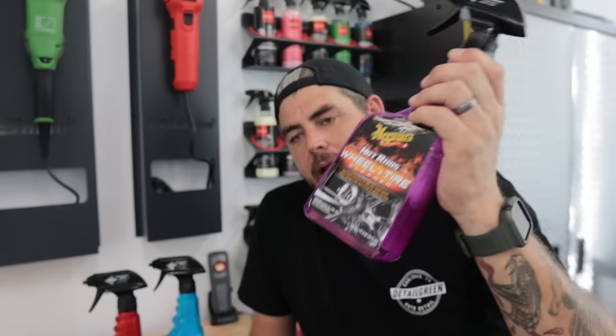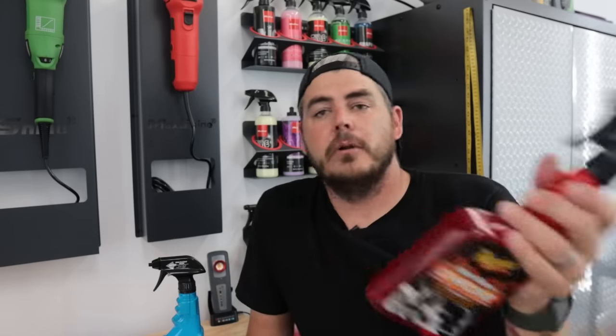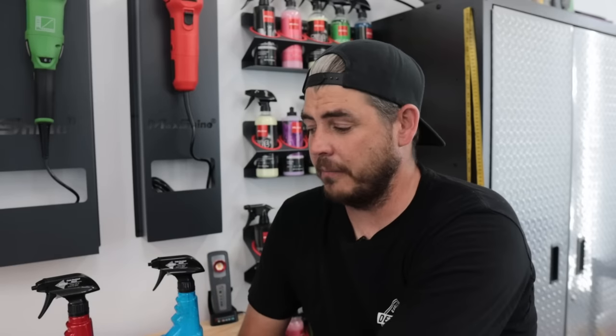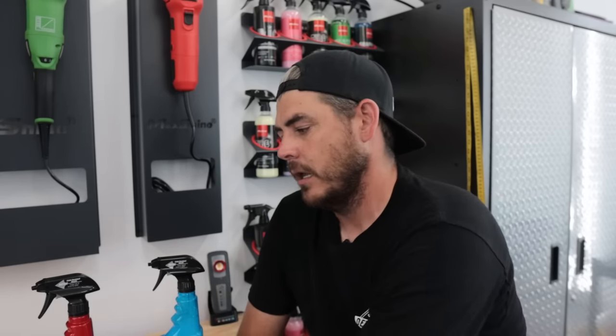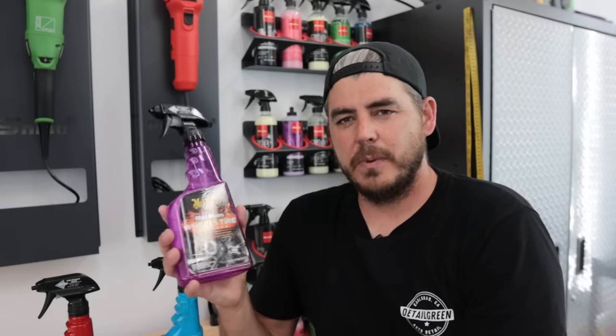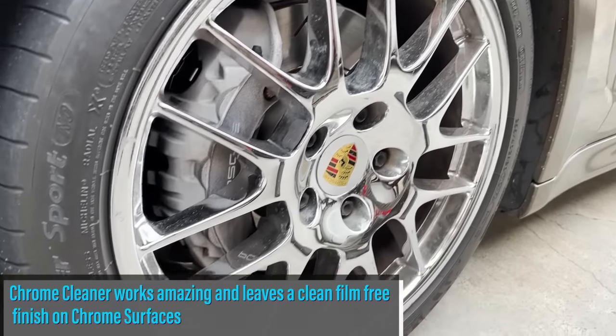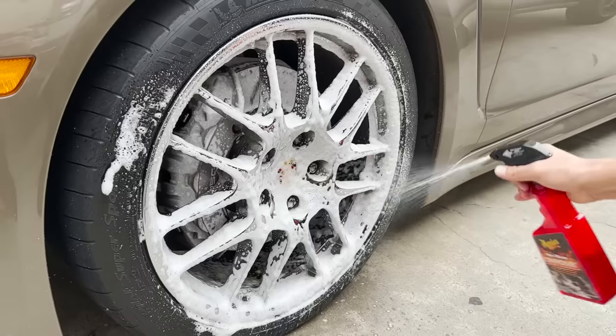So that's it. The go-to for me 99% of the time is the wheel and tire cleaner. Keep a bottle of chrome with you if you're doing cars for people — you never know when you're going to need it. And definitely keep a bottle of the aluminum cleaner because those sensitive surfaces can be damaged if you use too aggressive a product on them. So for polished aluminum wheels, that's very, very important. If you're only going to buy one, I'd recommend the wheel and tire cleaner and just use it very sparingly on any other surface. I actually probably wouldn't use it on a polished aluminum wheel because of the risk of damaging it. On a chrome wheel I'd be okay with it personally — use it at your own risk, test a little spot, spray it on, don't let it dwell too long, rinse it off, then fine tune with a microfiber towel. The chrome cleaner is likely formulated to leave less streaking on a chrome wheel versus the all-purpose one.